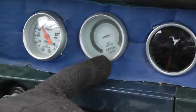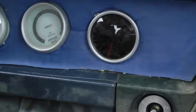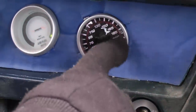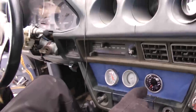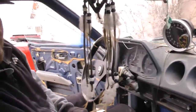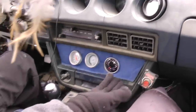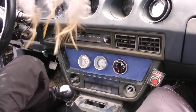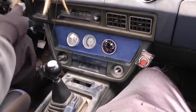The air-fuel ratio gauge tells you your parts of air to fuel — you want to be at stoich. Exhaust temperature varies by engine, but you establish safe operating temperatures and a high-range limit, and you want to stay a little below that so you don't put your engine at risk. Set yourself a high-side limit and say you're not going to allow your engine to pass that temperature. If you start getting too hot or running too lean, you need to jet up and go richer on the carburetor jets.